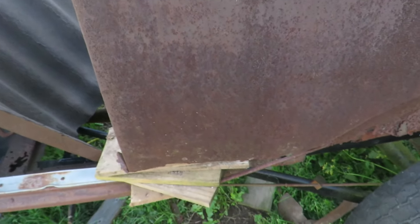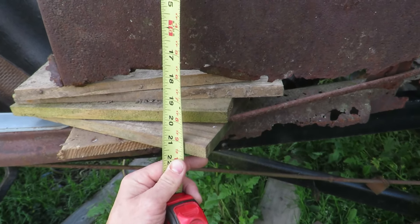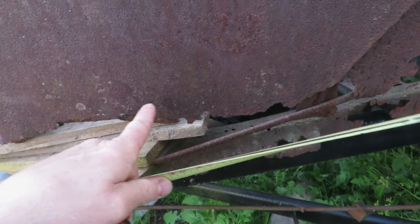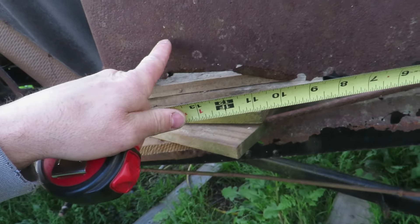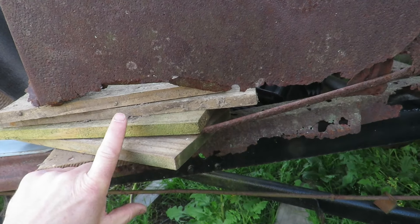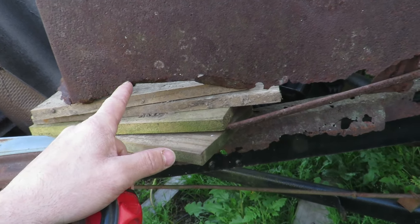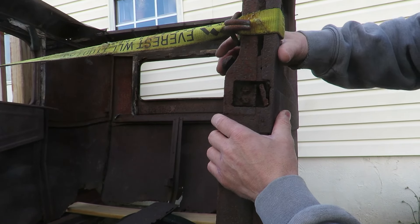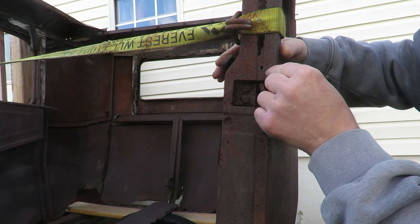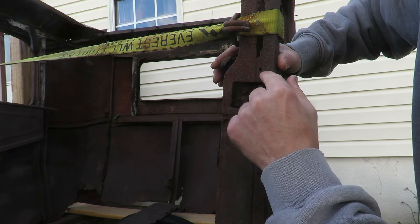As you can see I don't even really have 17 good inches right there, so what I'm going to do is probably chop it right at the 17-inch mark and see where it goes — see if it's solid behind here. Do 17 inches right there, and whatever the 17 inches to the 24 and a quarter is, that's what I'll end up making my panel for its entire length, and we'll get that all formed up. That forming portion is pretty easy. I gotta actually get that rivet — it's actually a nail that's in there — but this one's already got the hole in it, so I'll be able to push the side down and push the B pillar up, align those two holes, and pop a rivet into it.